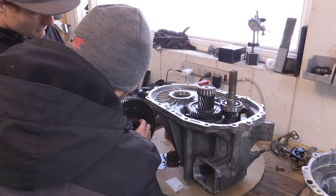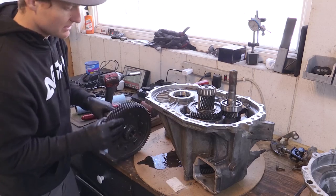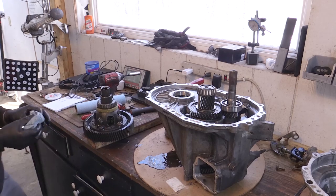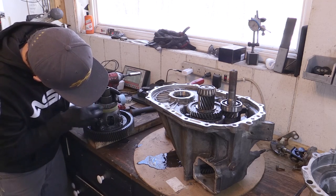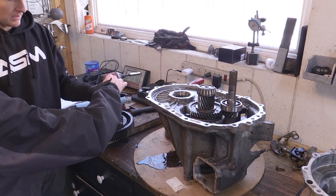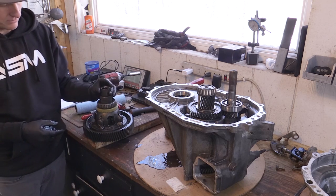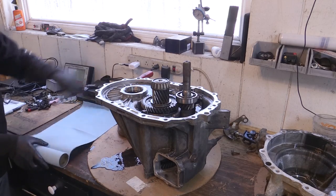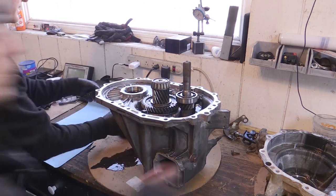Typically if you hear whining and noise, you really want to look at all your bearings for any pitting on them. This looks pretty good. That's the speed sensor there. And this is the torque tube — high horsepower drag cars will sometimes break that torque tube. This is that thing sticking out of the trans. The next thing we'll pull out is both shafts together, with the shift forks and everything. And over there is your reverse light switch.